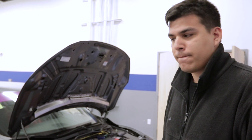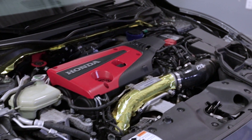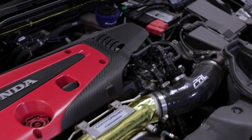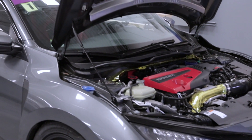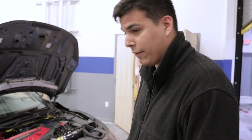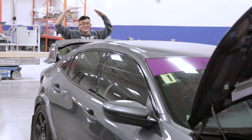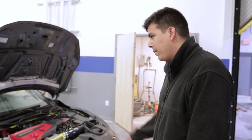What's the next step for the car? I'm going to deal with the cooling a little bit more — turbo blankets and a Chargified blanket to see if that helps. And potentially, if I have time, I'm going to try to mess with the oil cooler, maybe put another cooler on it and run a parallel system so it'll have two coolers on both sides. And some aero changes — putting a bigger adjustable wing on the back, maybe a hood.